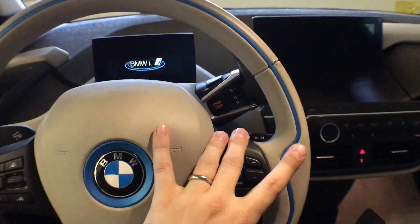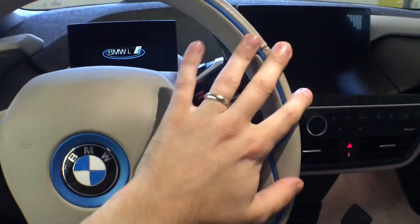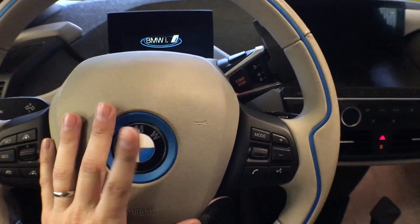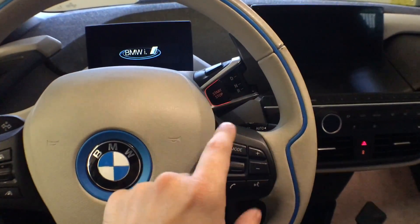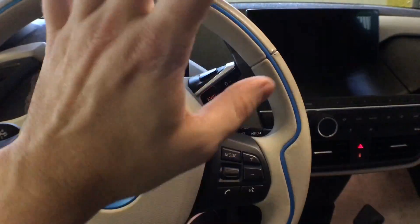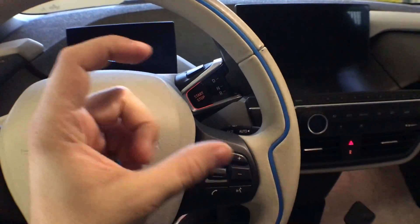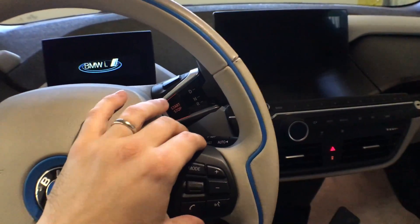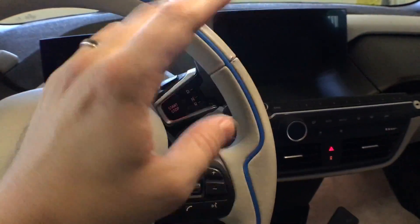Sure enough, there was a different steering wheel — this metal rim around here or something else built into it had a capacitive touch sensor in the European model, and the American model does not have that. So I knew I needed to either get that steering wheel or fake it and do a man-in-the-middle kind of thing and just constantly transmit over CAN to say, yeah, he's totally touching the steering wheel, everything's fine. Make a little module that could transmit that, like an Arduino with a CAN module, or I think Teensy boards can be modified to sort of bit-bang and do the job.